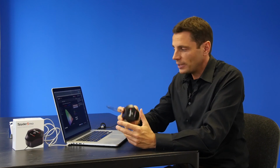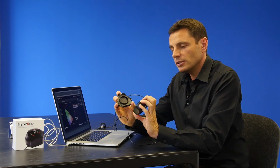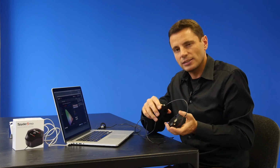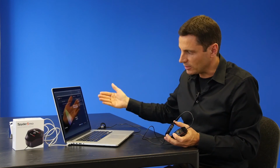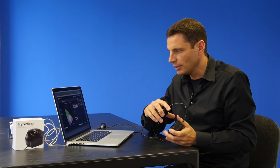So there we go. We've calibrated our screens. We've got to that situation where we're in a nice scenario of knowing what our screens can display and we know what we're working with. The benefit with the new Spyder5, we're actually seeing these devices now giving up to 55% improvement on calibration of older screens as well. And that's all down to that honeycomb focusing the light. It's cutting down on extraneous light. So where you've got some displays which have got a big glass bezel at the front of them and a lot of light scatter which can affect the accuracy of your results, this new honeycomb design is really helping on making sure you get that focusing of the light. So therefore, we're now in a nice calibrated scenario. Hopefully you can be too.